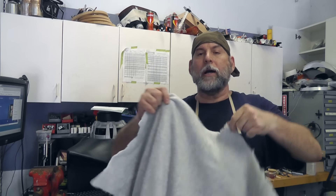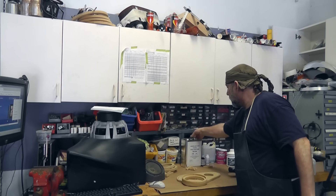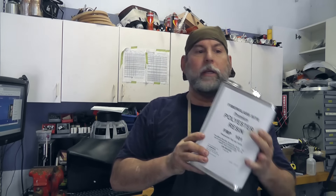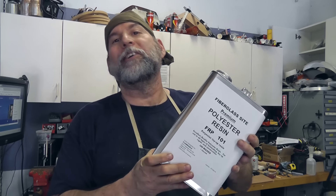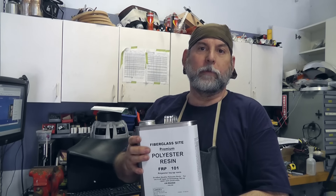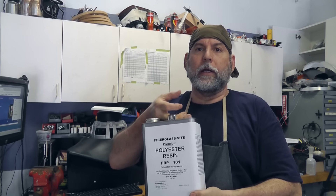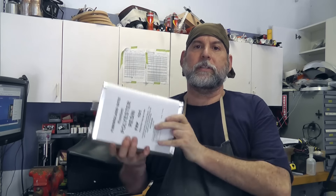This is stretchy stuff. In the old days we used grill cloth, which sucked — it didn't stretch, it took a lot of strength, and it never incorporated itself into the resin. So let's talk about resin. With fiberglass, I buy mine by the gallon — I get a new gallon every summer. There's at least one unopened gallon sitting around here somewhere. The way you dispose of fiberglass resin: pour all your hardener in, shake it up, it turns into a lump of inert material and you can throw it away.